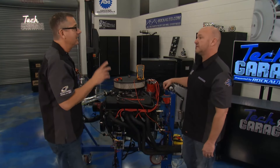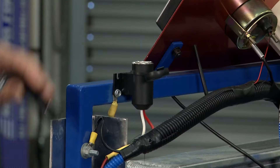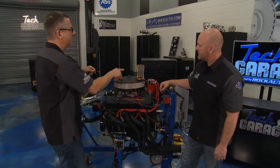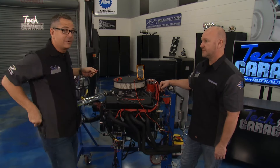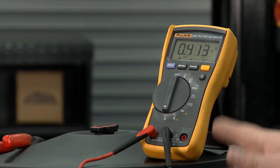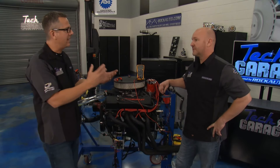If we turn on the ignition system, there's seven amps for the fuel pump system. That's not helping you, Paul. I want to show a cool thing - cell phone chargers. You put one in, you don't think much of it - there's a little light - not much draw. But if I take my cell phone out and leave it in the car overnight charging, bammo - 300, 400 milliamps all night long. Over time, it's going to kill the battery. Now, how do we find the parasitic drain?